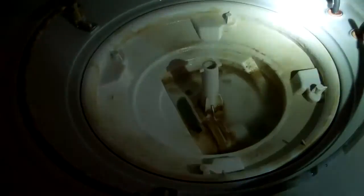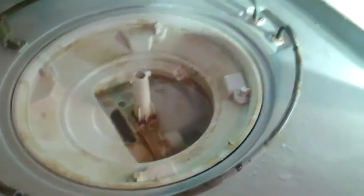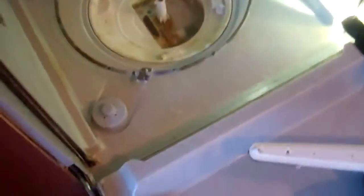Let me get my flashlight. So that's what it looks like in there. This is your fine strainer — you have stainless steel up top and plastic down below. If you grab down here, you can just lift it right out — just that simple. Down here you have pretty much the guts of your dishwasher — the spout where all the water comes out. Probably see those two metal screws back there — we're going to take those out. These are T20s — a T20 is a Torx. So we're going to take those out.